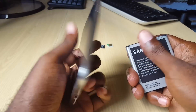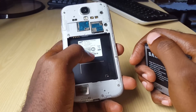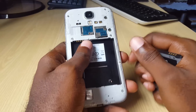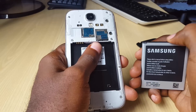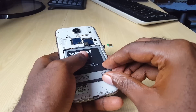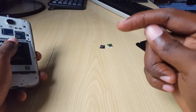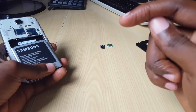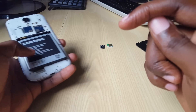Those are the main things to try. If none of them work, the final resort is to actually flash your phone. It's not easy for most people so I didn't go into that here — I'll do that in a separate video. If I have the video done I'll put a link in this video, but you can also click the link shown to go to the website where it shows you how to flash any Samsung Galaxy phone. That usually fixes boot loops around 90% of the time.